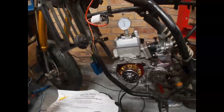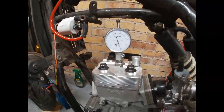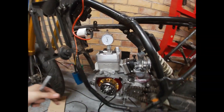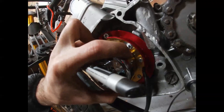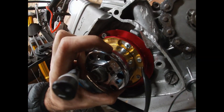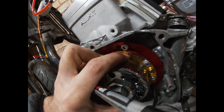The other mark is this one on the stator — should be that one, there. So basically we just find the top dead center. That should be the top dead center, right there. And we try to align these marks — one in the flywheel and one in the stator. If you look carefully, there is a graduated scale on the stator.